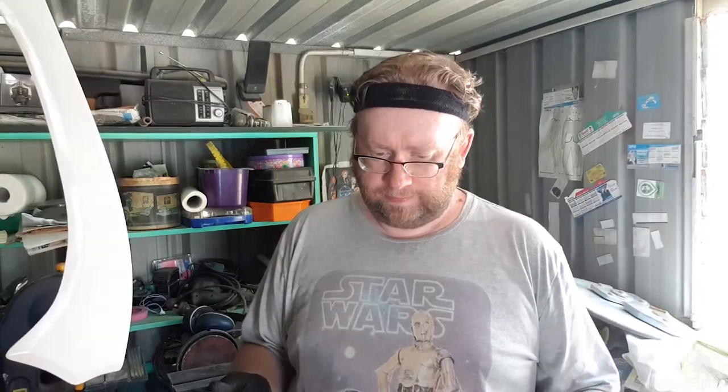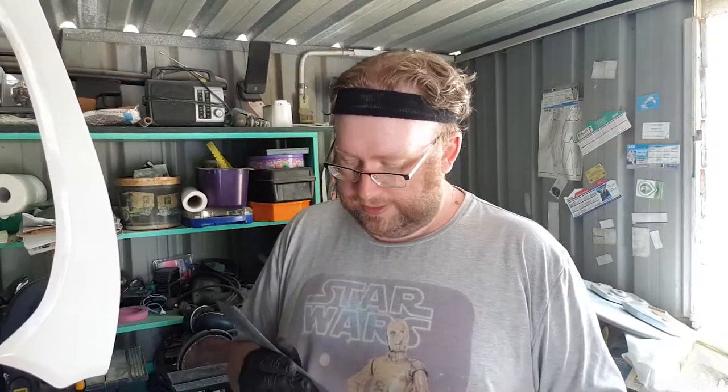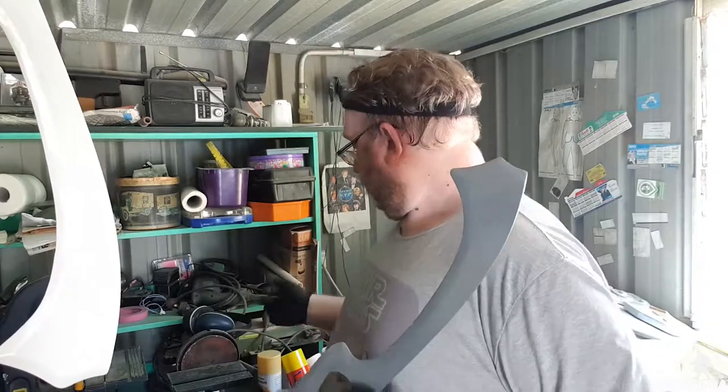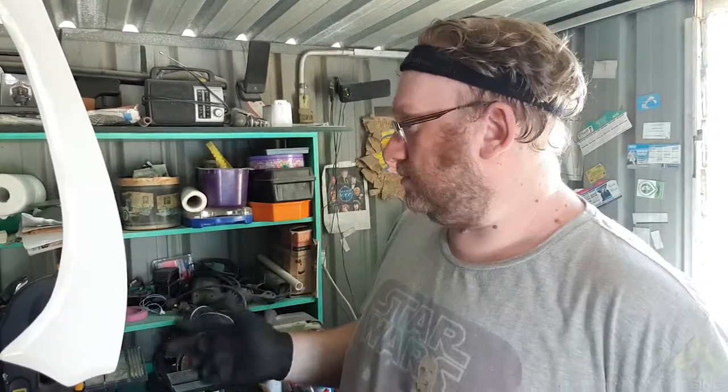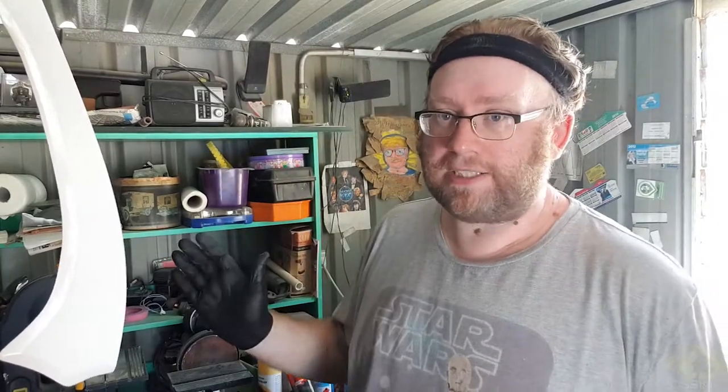As for now, I'm going to see where I go forward with this, especially because I've used a glass lacquerish product. I've thrown the can away, but because I've used something really kind of crap on this, if I try and paint this, I might have to strip all this back down. I might have to sand it back down, or I might go back over with some spray putty, and hopefully that won't cause any chemical reactions. The spray putty is pretty good. That's kind of a tip. If you do have a mistake, sometimes the spray putty can cover it. You just go back to the beginning, sand as much down, spray it with spray putty, sand, prime, etcetera. There's plenty of YouTube stuff about how to do all that.